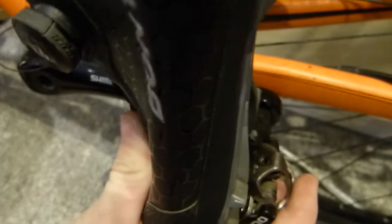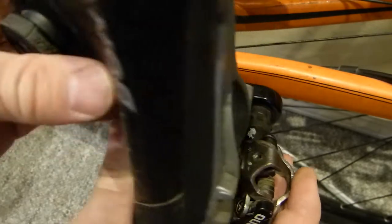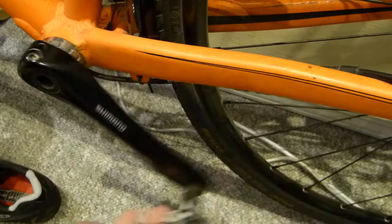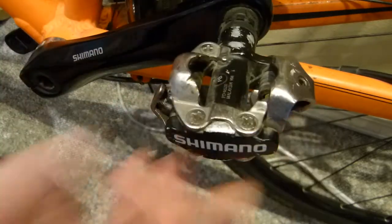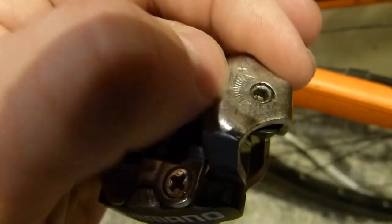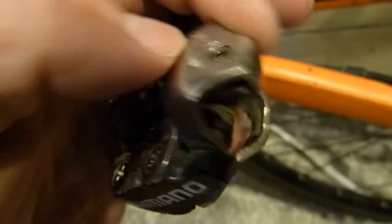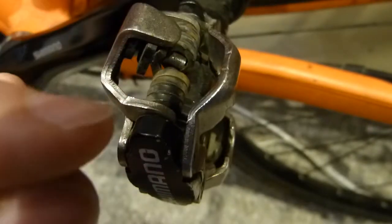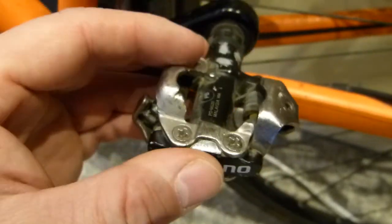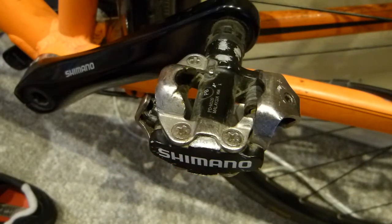Now, I can't exert nearly enough force with just my hands or thumb here to clip the shoe on, but this is the geometry of clipping, and the clipping force can be adjusted here on the pedal. If I tilt it towards you, you can see that there is an adjustment set screw with plus and minus symbols on it, that with an appropriate wrench the spring force can be dialed in to regulate how much force is necessary for clipping in and for releasing from the pedal.